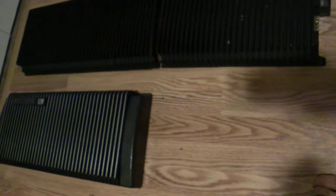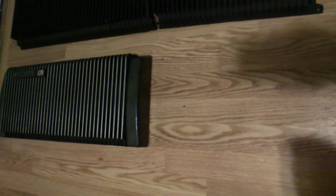These amps are extremely underrated. Kicker's cheater amps like the XS50 and XS100, but also the main ZR line, were underrated similar to how Rockford Fosgate did it. The ZR240, for example — I'm not sure how it got that designation since even its literature rates it at 280 — will do well north of 500 watts. The ZR1000 puts out 1,300–1,400 watts, and if you drop it down and do bursts you can get 1,800 watts with enough power. Unfortunately these only have four-gauge power input, which was common at the time.